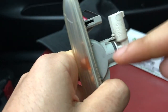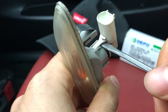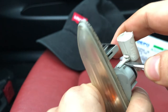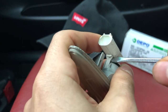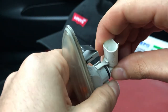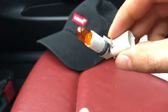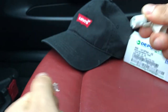So what you do is you see this tiny little spacer here — this little wing. You got to twist it counterclockwise. So you're going to put this in here to lift up that little thing. You see that? I'm lifting it. And what you do is you lift and you twist at the same time. I'm going to lift this up and try to twist it. Once I get it there, I'm going to use both hands. See how it's right there? Once you get it there, it's easy — just twist, comes right out. Just like that. Now you just need to take out the little bulb. You just literally squeeze it and it comes right out.